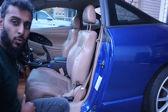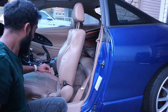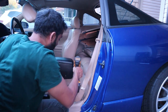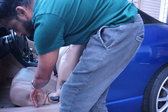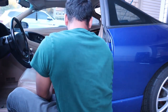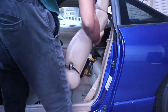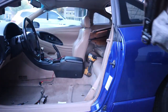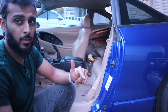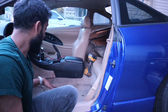There are two nuts in the front and two bolts in the back. You've got to move the seat forward to access the back bolts. There are wires plugged in — definitely, because of the motor. There's one wire for the seat belts as well as the motor. I'm not really sure if it matters if you unplug the battery or not, but I just did it to be safe. There's definitely no airbag system related to that.